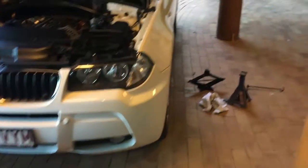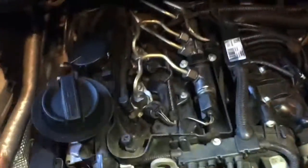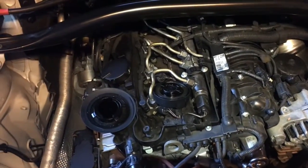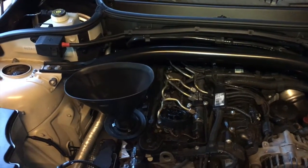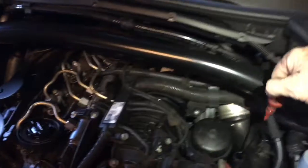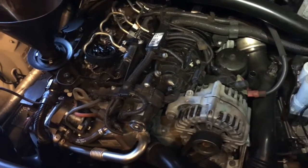Car's back down, jack's removed. So we're good now to undo this one here — no oil in there, so don't start the engine — and top it back up. I've got 5 litres of Castrol. I've got about 4.5 litres in there. If you haven't worked this out yet, you shouldn't be doing this — but that's your dipstick. Pull that out, check your oil, and top it up right where it says Max. Don't overfill it.